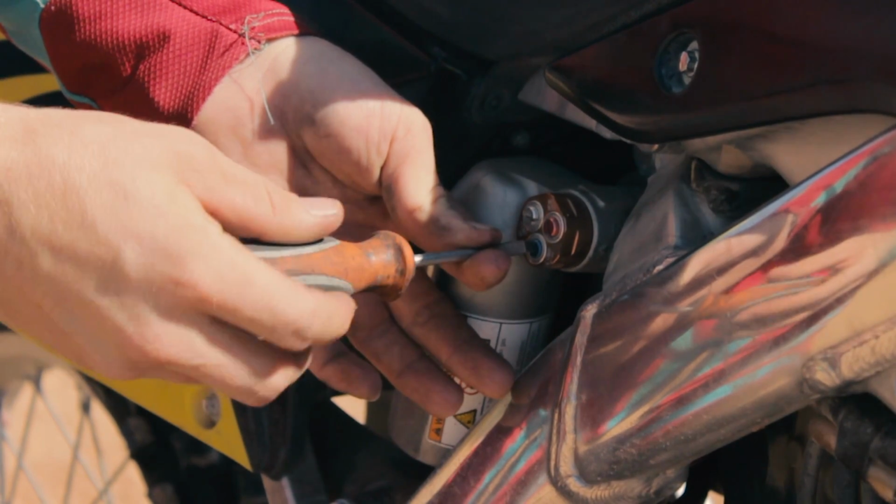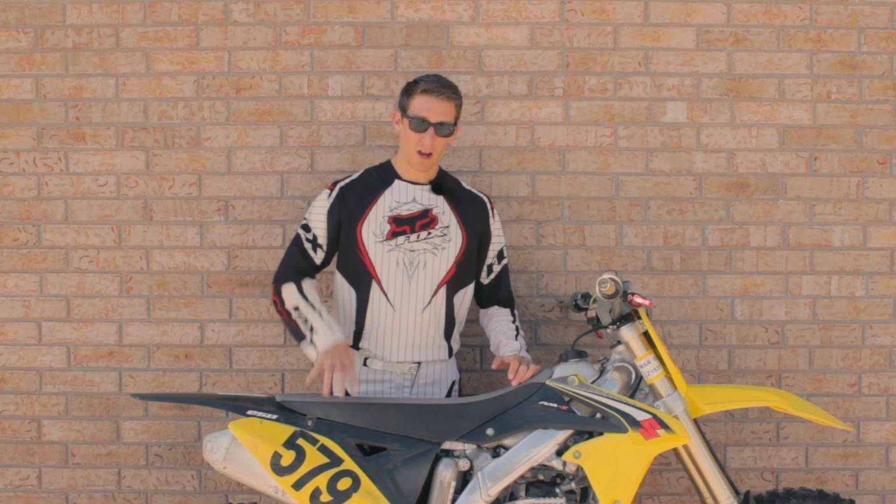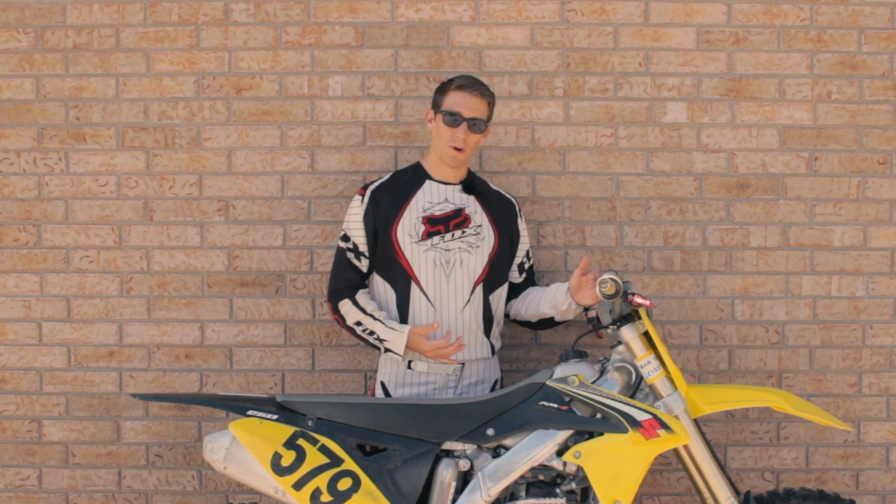For the rear, I think I would soften it maybe one more time, because we're in some soft turns, but I want the bike to sit in the turn just a little bit more. So I would soften the compression maybe 1 click. I would take it out and see on the small bumps: does it feel good, and does it still continue to turn?